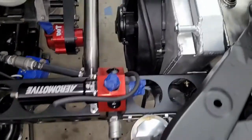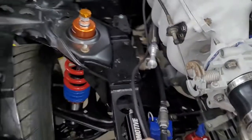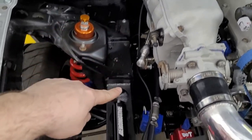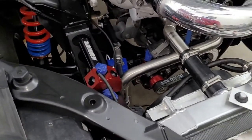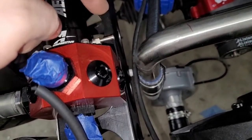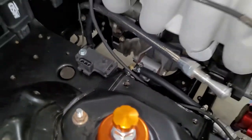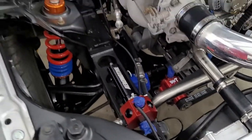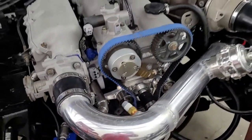And then our regulator, this thing needs a vacuum reference as well. So as you can probably guess, we got to get a T-fitting, and we're just going to basically go here and then zoom up here and catch the regulator. So that'll be pretty easy. And both of those have this small, these aren't quarter inch, this is like eighth inch. I could change this one, but this I can't do much about. So we're just going to use vacuum hose for that one. But we'll zip tie them and test to make sure that they're going to hold. I don't remember. That's probably enough.